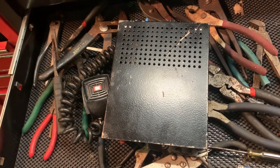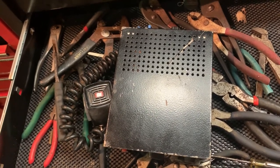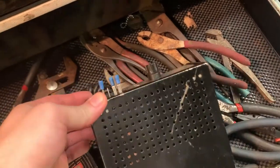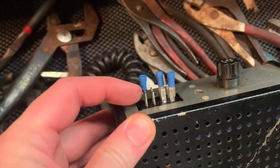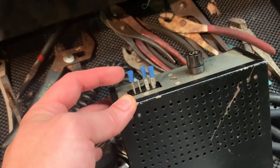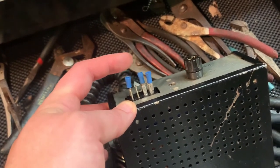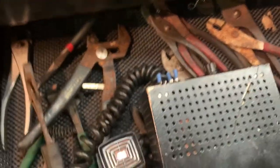I got it on eBay listed as working, and I think shipping and everything it was like $44. But it did not come with a wiring harness, and people want ridiculous amounts for the harness for this thing. There's not much to it — you can see the blades right there, it's an eight-pin connector. I think we really only use like four pins depending on which speakers we use. You've got a power and a ground and then basically two wires to the speaker — that's the basic hookup.